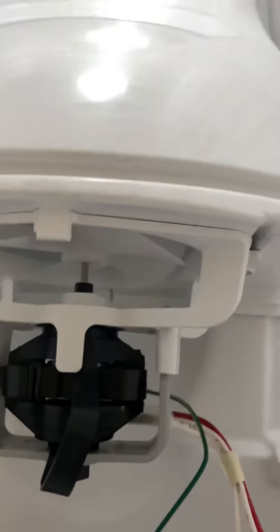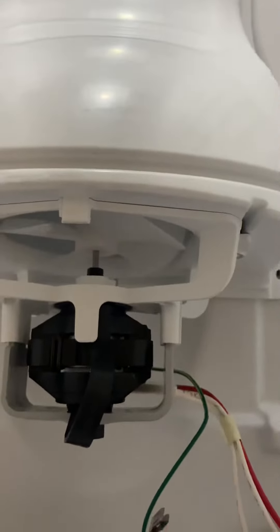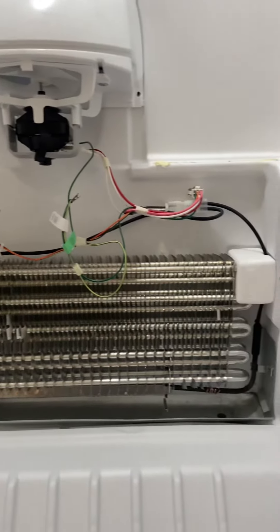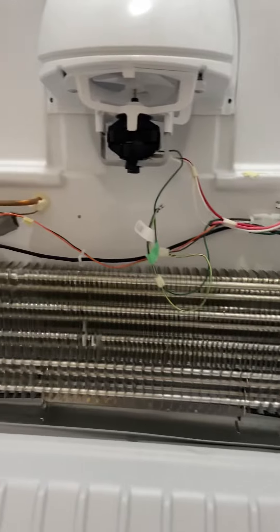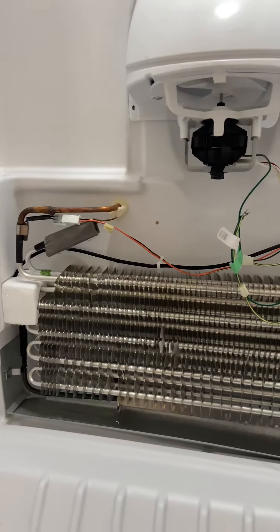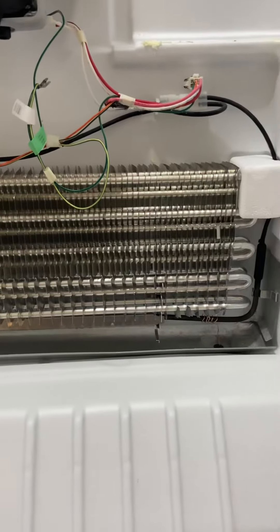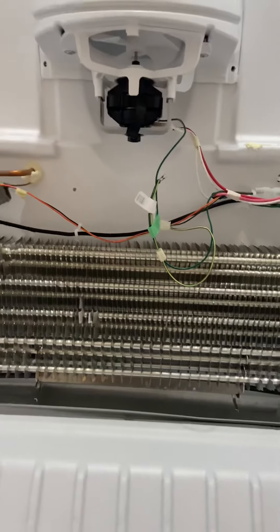Hopefully that'll prevent my next freeze-up. Besides that, you have to make sure your blower and fan are working, and you don't block the vents — that's the most important thing. Do not block the vents; the refrigerator has to circulate, or it will freeze over. I hope this helps you as it helped me. Thanks for watching.